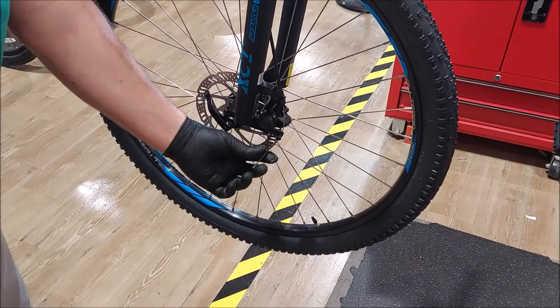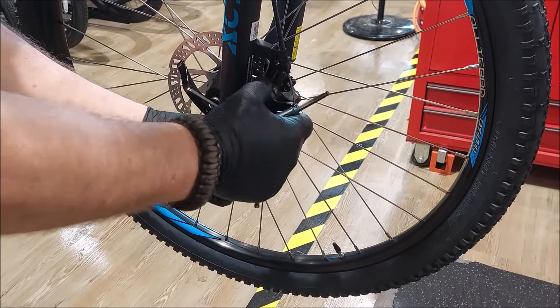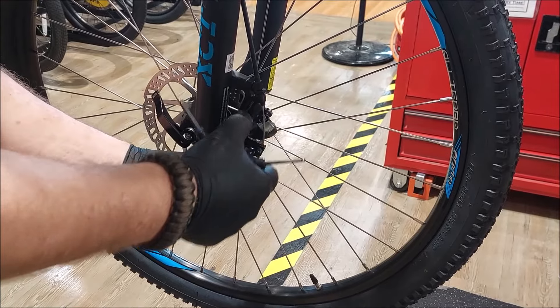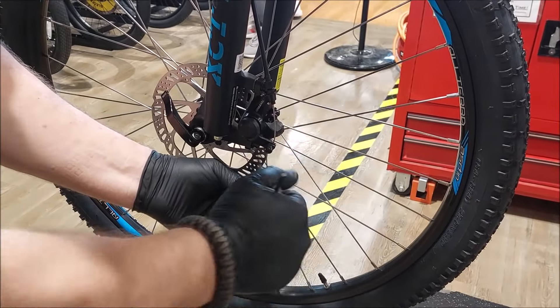When setting a brake cable, I want a certain amount of play — from all the way open to all the way closed. I'm mechanically turning the closure on the brake by hand. I want to find the point before I take up the slack. That's a practice thing — it's kind of a bike feel you develop.